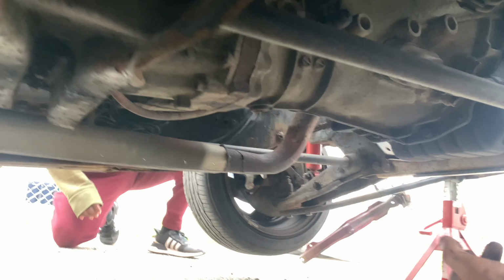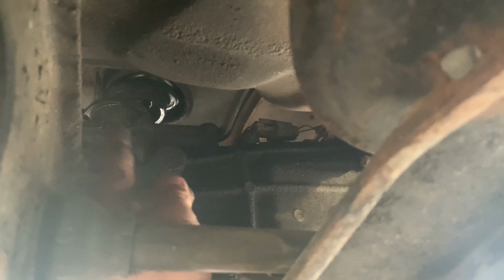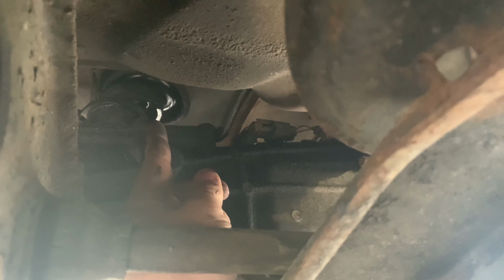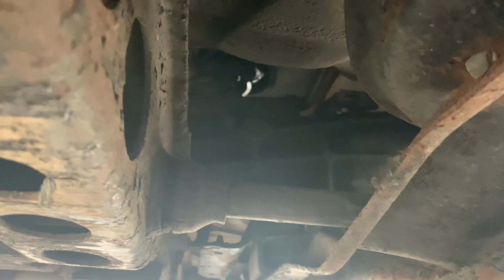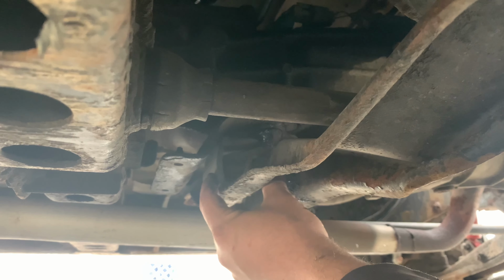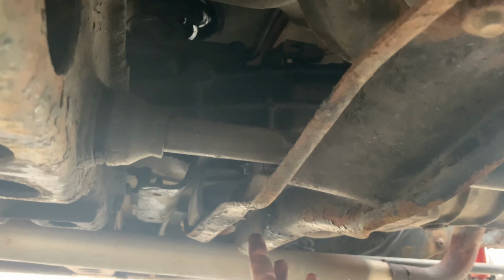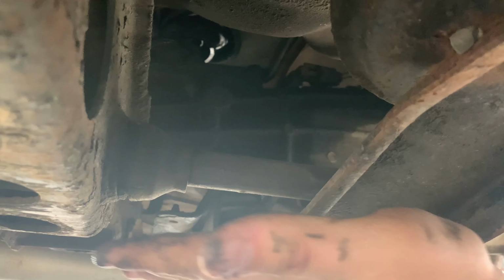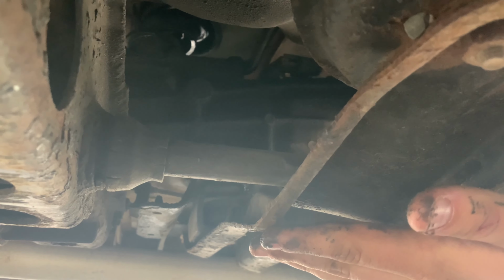So as we just talked about in the last video, the engine mounts are broken and you can see right up there, the transmission is pushed back and there's the boot that it's supposed to be on. So we're about 1.5 to 2 inches back. I think it's just the engine mounts. I don't know what gave over here. Yeah, it looks like right here, maybe, I don't know. Something gave out over here. This is obviously twisted a little bit, this whole brace, but something had to have given out over here to allow the transmission to have the play to move back. But I think if we get the new engine mounts, we can pull the engine forward and reseat it where it needs to be.